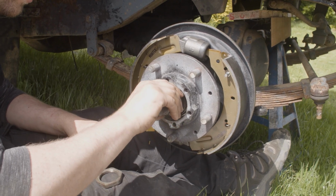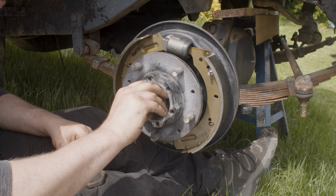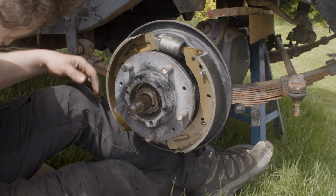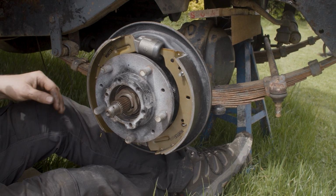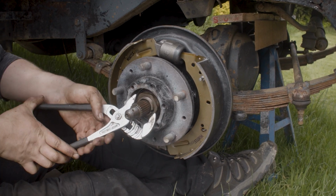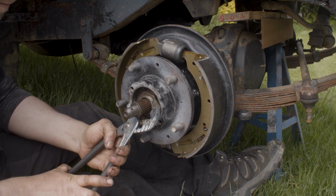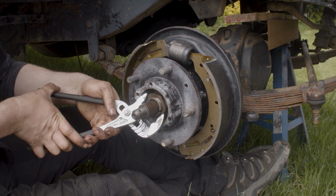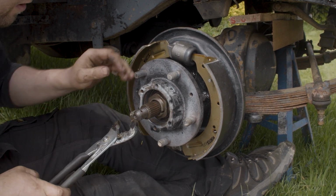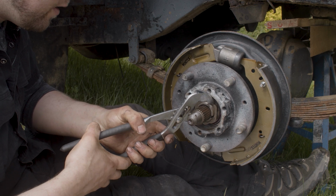The way we measure the tension is using a dial indicator gauge. You always see me with dial indicator gauges, but they have a job. So before we put the indicator on, we'll get our adjustable C-spanner here, or water pump pliers, and we're going to give this a nip up just to seat everything. The same as with the punch. You've seen me with the punch before. We're just giving that a nip up to seat everything, and then we'll bring it back down to the clearance. This is something that you shouldn't miss when you're putting in any kind of taper wheel bearing. So see, that bearing now is way overloaded. Okay, I've loaded it up here, so we can back this nut off then.